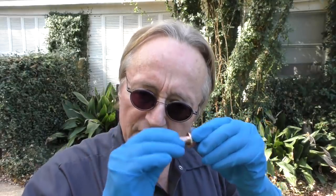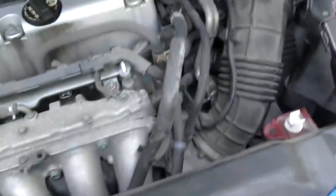Here's the new valve - you can hear it rattle because it's got a little valve inside. It will suck vapors, but if oil gets in there, the valve shuts so oil doesn't get sucked and burned. When they get old, a lot of times that system breaks down, then they'll suck oil and burn it. It's a simple system if you know where to look.